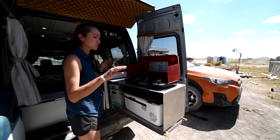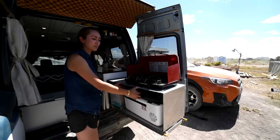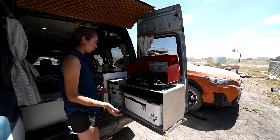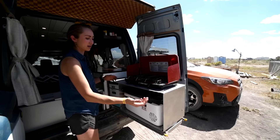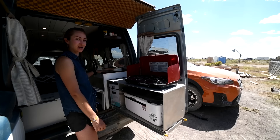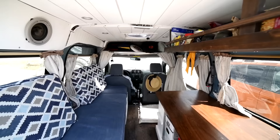One thing I really like about this is that we made it out of eighth-inch aluminum. Some of my friends who do metal work consulting back in Wisconsin knew I was going to try to build this out of plywood — using half or three-quarter inch plywood for the whole thing — and I was going to lose so much space because each one of these faces was going to have to be a lot bigger. By making it out of eighth-inch aluminum, I was able to save a whole bunch of space and fit in not only a fridge and my Coleman, but even have space for these drawers that stay inside. I think that's one of my favorite things — making this out of metal — and I think that's pretty unique.